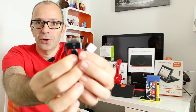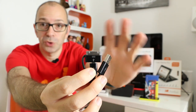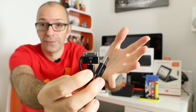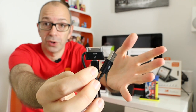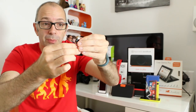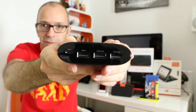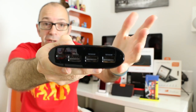The included cable has a 30-pin dock connector tip, which will charge the iPhone 4, iPhone 4S, or previous generations of iPads, with full-size USB on the other end. Even more convenient — this little adapter comes off and you've got a micro USB connection as well, so it's a really versatile cable. On the battery itself, we've got an input for charging on one side, and then various outputs: universal outputs for regular charging, plus a smart output with higher amperage for something like an iPad 4 for faster charging.